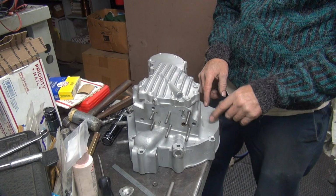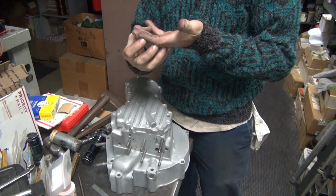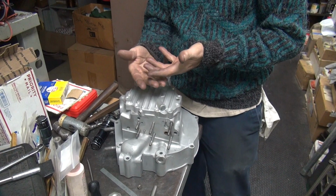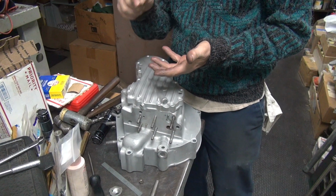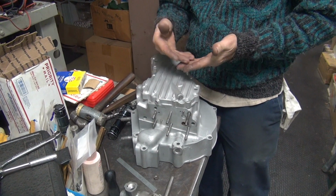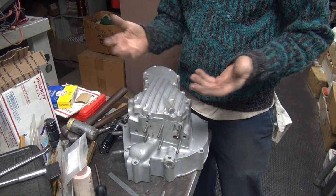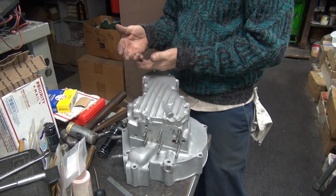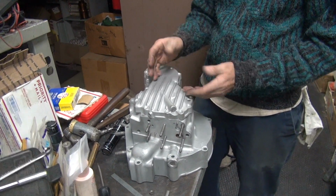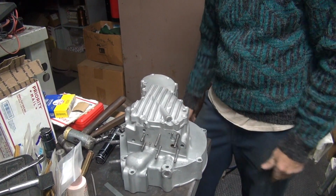I've actually welded cases where the buildup will melt. I would melt the aluminum away from the buildup, and you have the scale sticking up there, about 20, 30 thou above the weld. Wow. And you just touch it and it flakes off because it's scale. It's like crystal, but you can't weld to it. It won't weld to it. You keep going across, it just follows it across because when you melt the aluminum, you can weld to that. That's fine, but the scale is scale. The scale drops into your weld and you blow it out, but you can't get a nice clean butt weld to it.